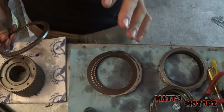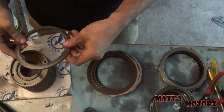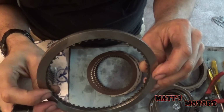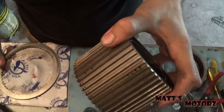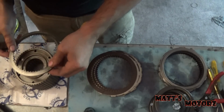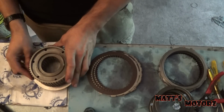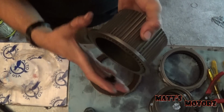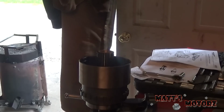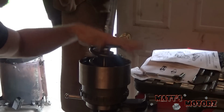Alright, so the overdrive clutch assembly is really confusing, so follow me on this one. First, we have the reaction plate. Now the reaction plate is counterbored. You see that? How the teeth go in? And this hub here has these guys that will catch those teeth. So we're going to put this on like this, facing down. It goes all the way down, and then this part should be flush. That's how you know it's on right. Okay, we're going to put this big spring and seat it on the plate here.